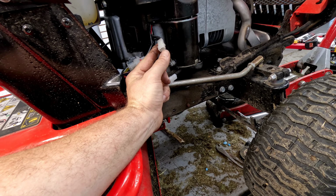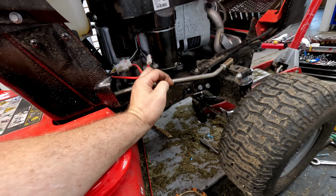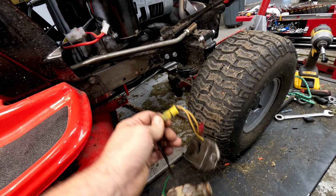Anyway, here on this one, since it's got the diode, you're going to go ahead and test DC voltage coming out. You test the voltage between these 2 pins on the inside. That should be right around 13.8, 14, somewhere in there. Anywhere between 13 and 14 is fine.